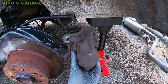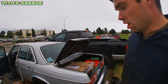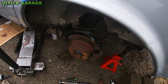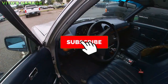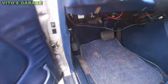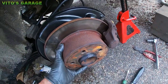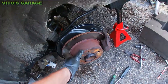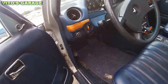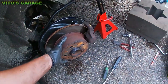Some updates: I just put back the parking brake assembly and mechanism and adjusted the parking brake. Everything is assembled. Let's go ahead and try to use this parking brake — look how tight it is. Let's try to turn the wheel right now. It holds pretty good; it's adjusted properly. Now I'm going to go ahead and release it, and we're going to make sure that it's free — and it is. All right, great.